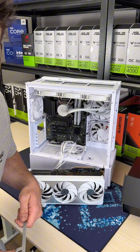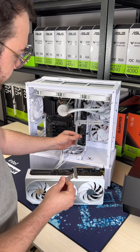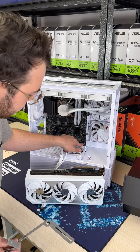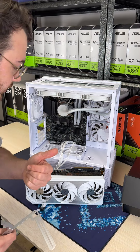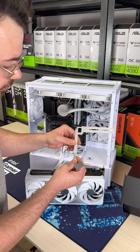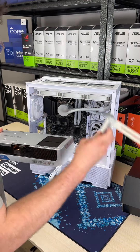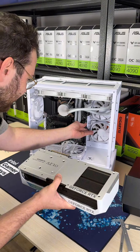So some good news and some bad news about the GPU. The GPU does come with an included sag bracket that you just connect to the motherboard and the GPU holds in place. The bad news is that with this motherboard in particular, it only has one ARGB port and it's placed right where the sag bracket would go. So you can either choose ARGB color or the sag bracket — the sag bracket is definitely more useful. However, there are alternatives which we will be including, like a standoff right here. Sadly we can't use the included bracket, but we do find alternatives. Let's get that GPU plugged in.